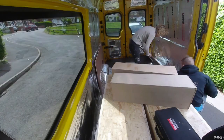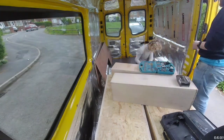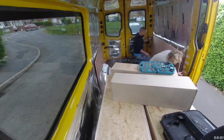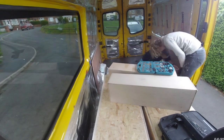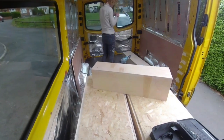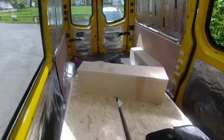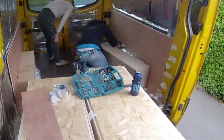What we found is that you obviously want to attach it to the metal skeleton on the inside of the van, but a lot of that skeleton has random holes in it. So we just use masking tape to mark where those holes are. There are a lot of times when you put the ply lining over it and you can't see where those holes are, so to ensure you're not just drilling your ply lining into nothing, mark.